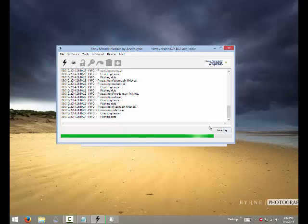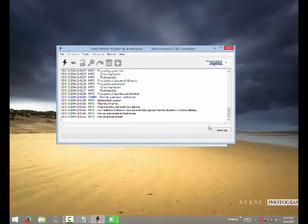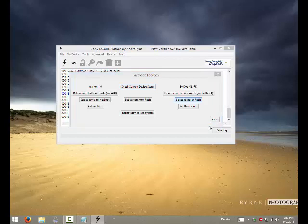You'll see it's finishing the flash — it won't take much more time. As you can see, it took from about 9:10 to 9:12, so just 2 minutes. Once it's done, unplug the device. Then press volume up and plug in the USB cable at the same time. Your LED bar should light up again, and the flash tool will show the device connected in fast boot mode.